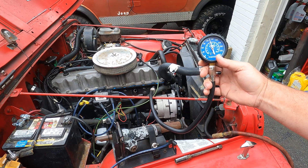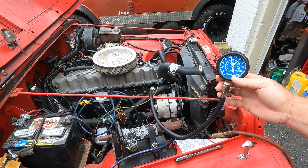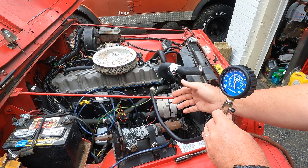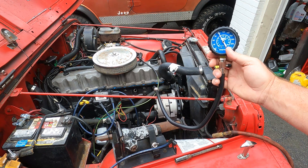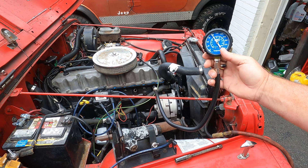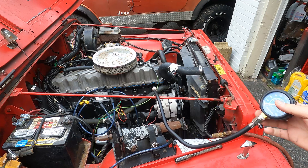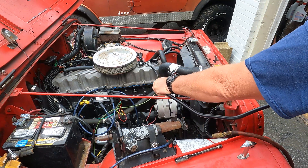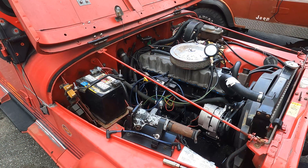I think I have a leak in the gauge, but we were up around 150 — it's going down to 120 now. When the air comes out of the cylinder on the compression stroke it stays in the upper tube; there's a Schrader valve in the line which I think is actually leaking. Now we'll test cylinder number six, the last one in the series. We've been getting about 148 to 150 on every cylinder, let's see how this one goes.